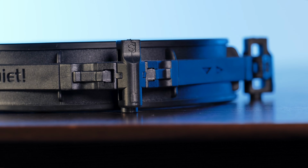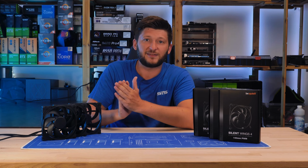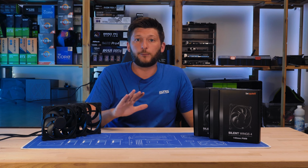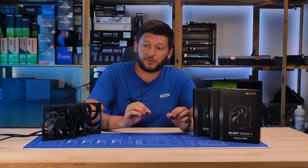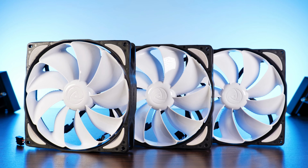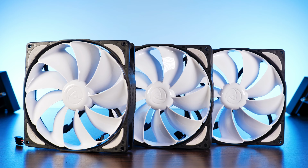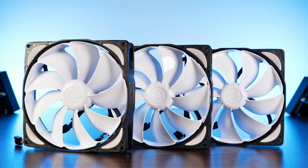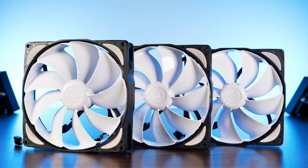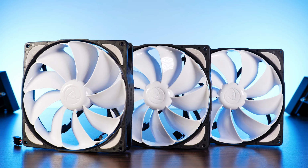And by reversing those, you would take away that small gap and make it completely stick against the mesh filter. Now, although the gap will probably not change anything performance-wise, it can change something regarding noise. There are instances where a specific combination of a fan blade design paired with a mesh filter can produce a horribly annoying sound. As the perfect example, Noise Blocker and basically any mesh structure. Horrible combination without a gap.